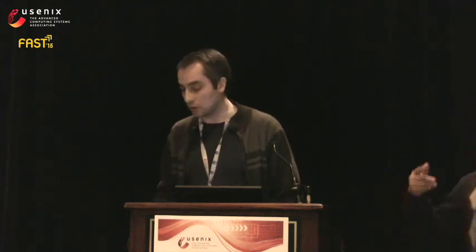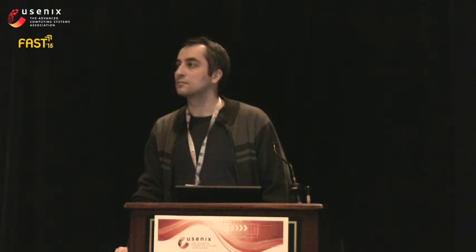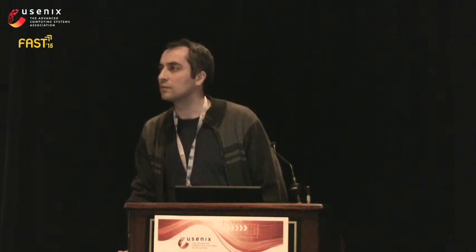Thank you. I have another question. I saw in your paper, when you characterize your band size, you use garbage collection algorithms. Sometimes it takes like half an hour, because the write normally doesn't trigger the garbage collection until maybe half an hour. So do you have a quicker method to characterize the band size? With aggressive cleaning, detecting band size is easy actually, because it happens in a matter of seconds.